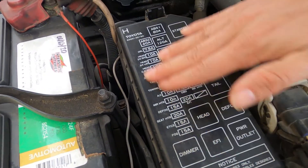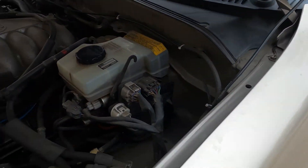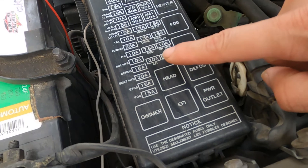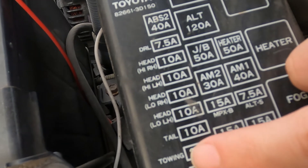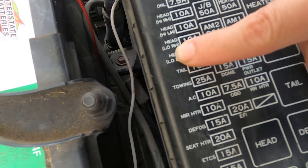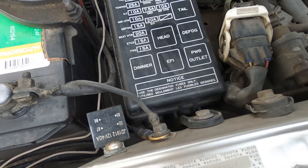Next, we can come to a fuse panel like you'll see here in most engine bays. Typically you'll have one body control module in the car, or some might have multiple. We can come over here and look at both our headlight relay and we're going to have a couple fuses as well that run for this — the headlight low for left and right side. So we're going to check both of these fuses and we want to check this headlight relay as well.